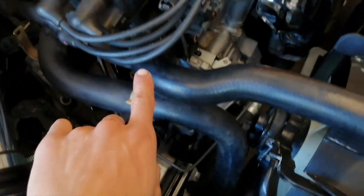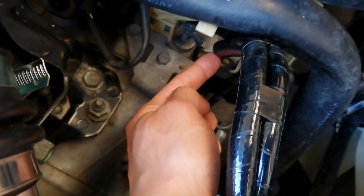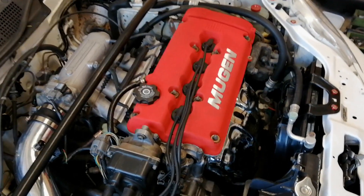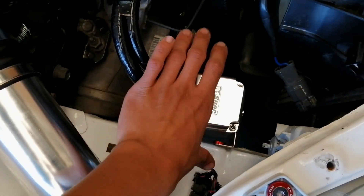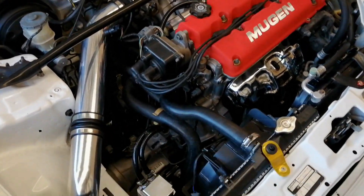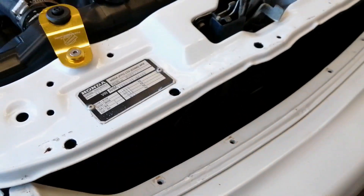I ran this pipe all the way to the valve cover right there, and this other pipe I just ran to this point right here — that's how it will basically breathe. Many people just fit a breather filter right here and let the engine breathe that way. For me I wanted the oil catch for show purposes, and this connection lets the oil catch be visible while also semi-functioning as a breather up to this point. I still need to get a breather filter for this pipe, but for now I think that will do perfectly.